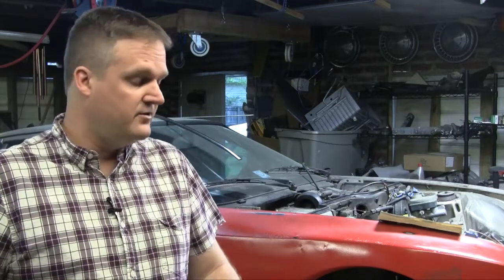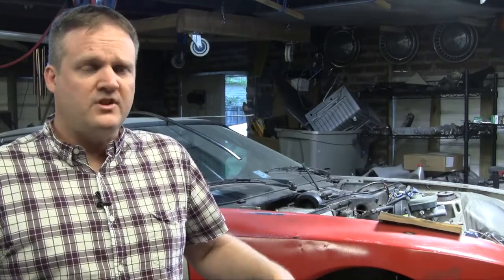But when I looked at it with a little further inspection, it seemed a little dirtier. Some things just didn't seem right for 25,000 miles, so I wasn't sure about it. I got advice from the boards and you guys to check the number 2 rod bearing, and I did. It really didn't look too bad, so who knows. But since the oil pan was off and the bearings were there, I thought, what the heck, I'll just go ahead and replace those bearings.